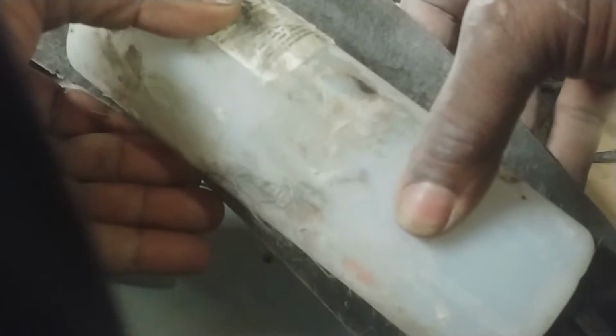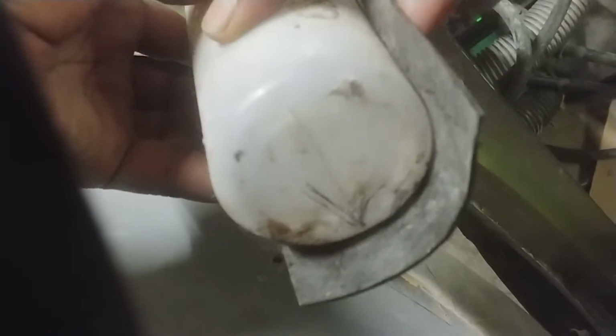Hold on a second. So go back with our heat gun, and we're going to heat this up. We're going to move my chemical away, right? So we're going to heat it up straight. See how it's getting light? Now the cool thing is, you can do this more than once in case you make a mistake. I typically will just get a brand new piece. Now while it's still hot, you roll it. Put that contour in it. See that? That's just going to be uniform all the way through.